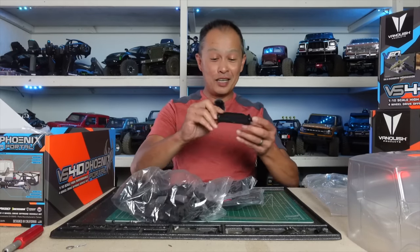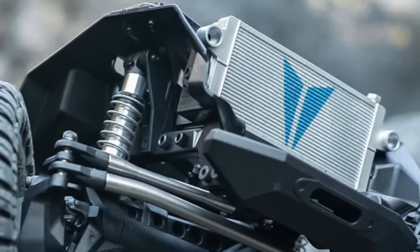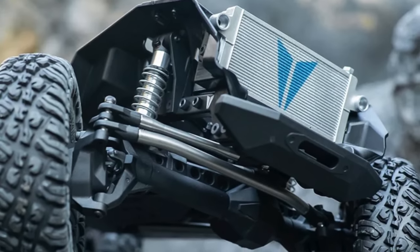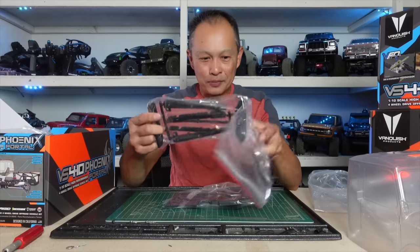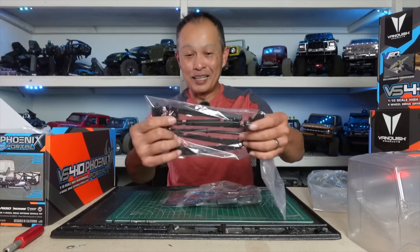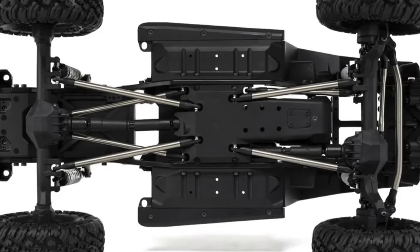This is a molded piece for a radiator — it's pretty heavy. These are your bumpers, and they're super neat because they're so small. If you look at a Jeep bumper, they don't cover your wheels; they're not meant to survive a big freeway impact. They're just meant to hit the rock and get out of the way. So these are tiny bumpers — it's got a winch, and this is your rear bumper, also tiny because bumpers just get in the way. And these are your sliders — they seem like they're part of the chassis, wider becoming narrower, which allows you to pivot around rocks.